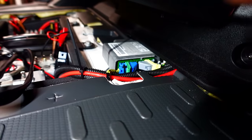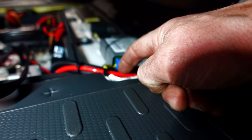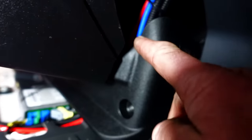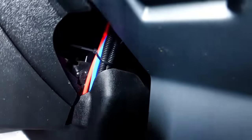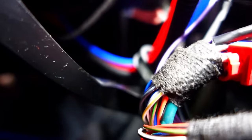Basically what we've done, so there are two air pipes in the conduit and the red one is coming up through, and I just unscrewed this and then we've taken it up behind here nice and neatly and cable tied it all up. Then you can see the blue actually, because that's where it runs out of conduit. And then down behind the dash, I've even put in a nice little rubber clamp just to clamp up where it comes up around the angle. So it's a job to see it, but it's obviously down behind the dash. We're just trying to keep it nice and tidy.